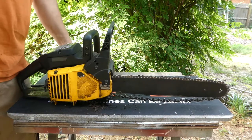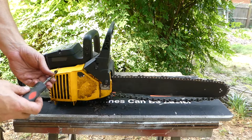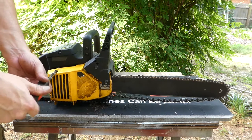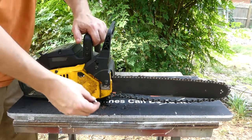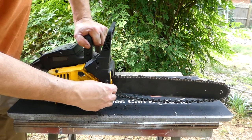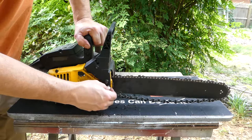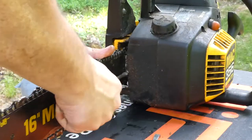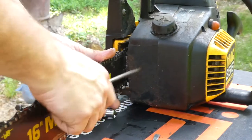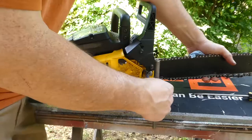It's easy to do, especially at the bottom near where it connects to the chainsaw — it can sometimes get bound up there, and then it will not tension. Putting this back on, just put your cover back on, loosely put your nuts on, and then you can use the adjuster. It's a little inconvenient because it's right next to the bar. Once you get it set up, tighten it up and you're done.